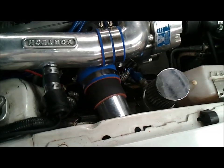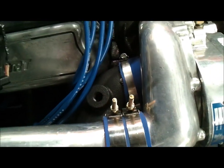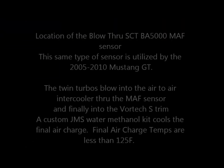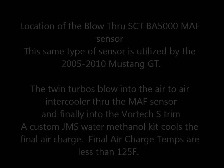The S-Trim was the one that was on there with the original engine. The result of running the 50s into the S-Trim was a substantial increase in power between 1,000 RPM and around 3,500 to 4,000 RPM. Looking at the dyno graph closely, you can see at about 4,500 RPM the car makes approximately 585 foot-pounds of torque at the tires with a locked converter.